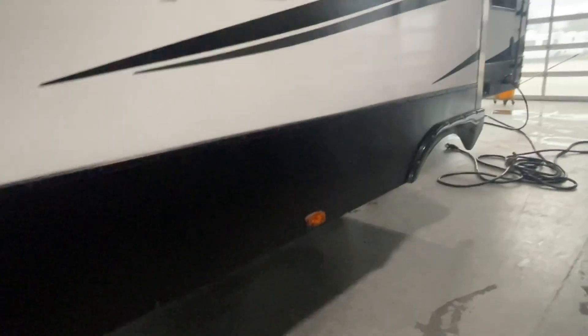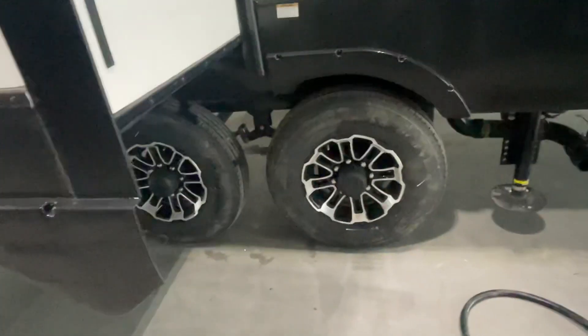You've got a propane tank on either side of the camper. On the other side you're going to have a regulator. Righty-tighty shuts off the tanks; lefty-loosey opens up those tanks. It is a good idea to check the lug nuts on the tires after the first 250 miles because they can become loose — just for safety reasons, that's a good measure of protection.